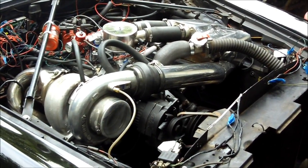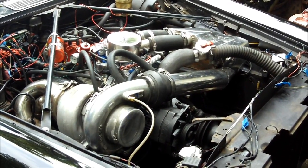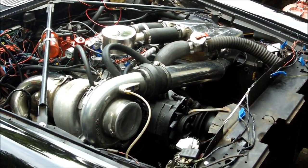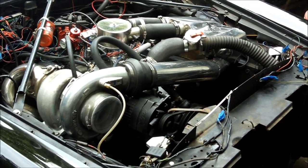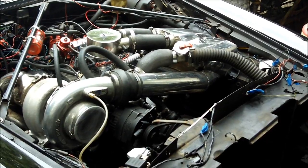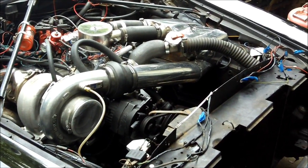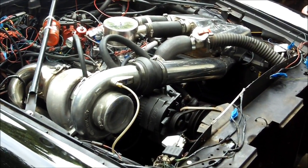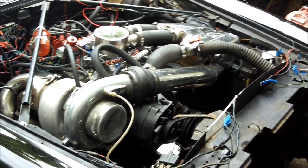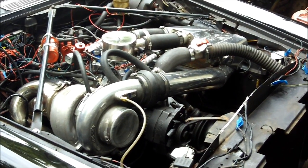I'm thinking I'm just not getting enough water in the dyno, but it's consuming enough fuel that it should be making 680 pounds of torque at 5000 RPM. So it works out like, if the dyno is right, if I can get enough fuel, it'd be about 660 horsepower at 7000 RPM. And if the fuel consumption is right, it should be in the 800 horsepower range, which is a bit much at the boost level I'm running. But anyway, I figured to test the dyno I'd stick another motor on it, something bigger.